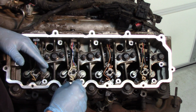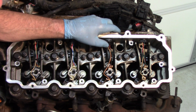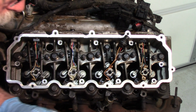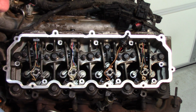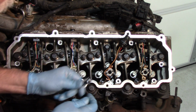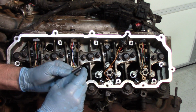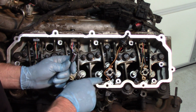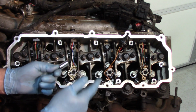That being said, let's go in and take a look at the injectors, because there's one other real common problem on 6-liter injector R&R. And that is, pop the clip out here, the problem is on the solenoids. Some technicians get in a hurry, and rather than use the proper long shank tool on these injectors, they'll use a short shank, and the size of the head is so large that it creates issues. When you put it in to remove the hold down screw, side pressure will crack the solenoids. Not a good thing for the core nor for the new injector that you're putting in.